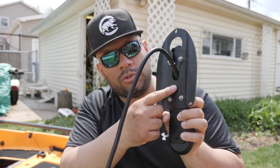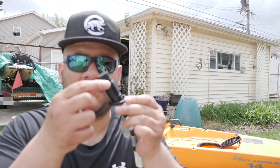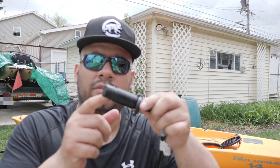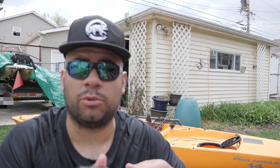Line up the two holes — there are two screws, one goes here and one goes there. Just like I had issues with other through-holes getting the back nut over the connector part of the transducer, same issue here. It's about an inch in diameter and the locking nut gets caught right after the female connector part. I put a little WD-40 on there, twisted it like I was screwing it on, and it slipped right over. If you have this same issue, don't force it — just lube it up a little, twist it down. All the threads are intact which is important for a good tight seal.